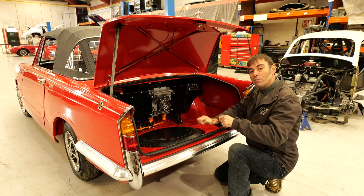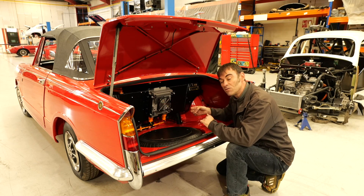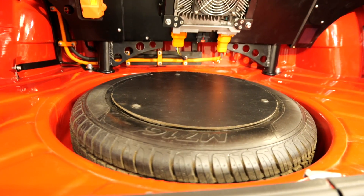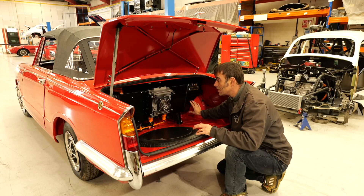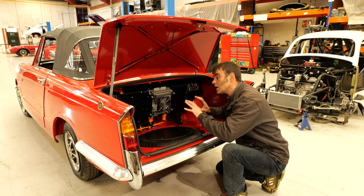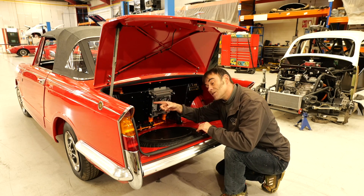In the rear is where we've got the rest of the bits and pieces. We've got the remainder of the battery pack in here — that's a 30 kilowatt hour total battery pack. Range-wise, that's probably around 100 miles driving normally. You've got the 7 kilowatt charger in here, your low voltage fuses and relays over here, and there's a BMS panel — just a screen. We're going to have a carpeted board here to protect everything, because if somebody's throwing luggage in you don't want anything getting damaged. You've also got your high voltage service disconnect there.